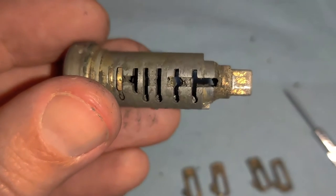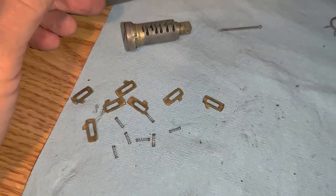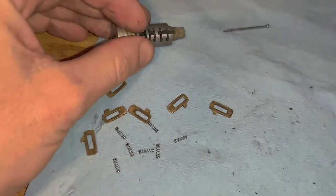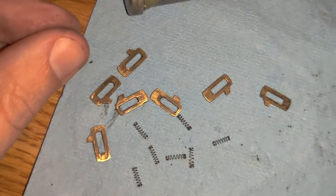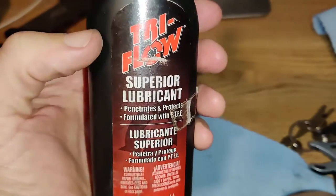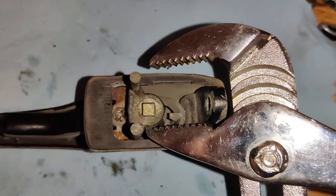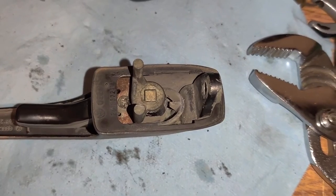I've been labeling these plates. I'm going to pull out those little screws and then clean everything up. I used some brake cleaner and that worked really well, though I still had to scrape them out with a screwdriver a little bit. You don't want to blast these into next week with the brake cleaner, so that was pretty tedious. I used Triflow — hopefully that'll work. Assembly is pretty much the reverse of disassembly. Just some channel locks — squeeze that pin back in there in a controlled manner. That's about it.